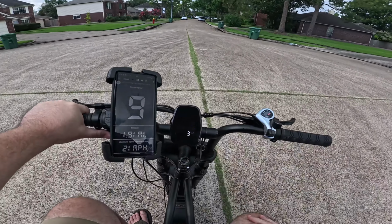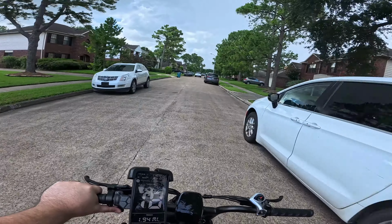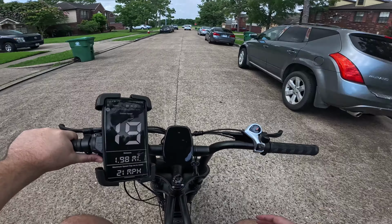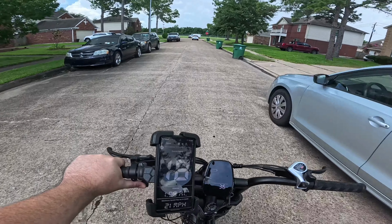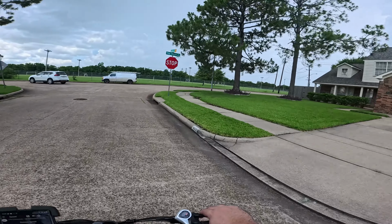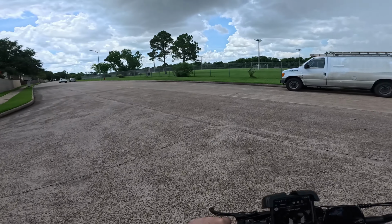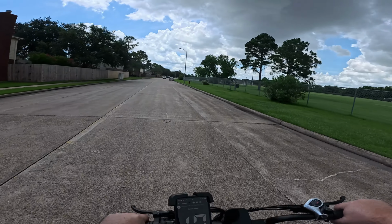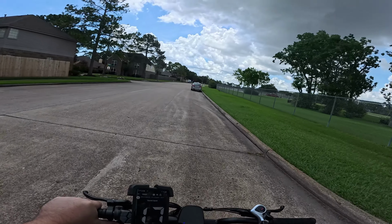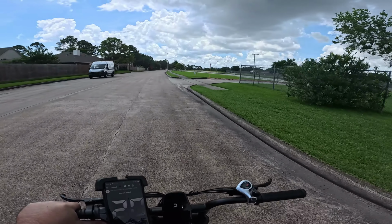I've been waiting for a company to ship me a bike that I can do some upgrades on and mess with, because you can get an aftermarket battery, motor, and controller and fit it into the way this looks. You could probably even get a 72 volt battery that will connect the same way as this one, run that to a better controller, and then maybe get a QS205 motor. I would get a 4T, maybe a 3.5T, maybe the 3000 watt version, and then run maybe 100 amps or something like that. Make it, I don't know, a 50 mile an hour machine.